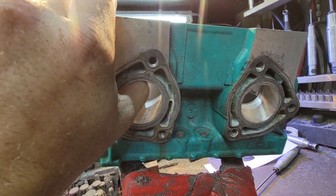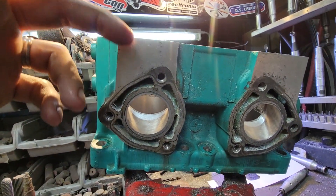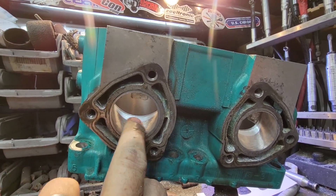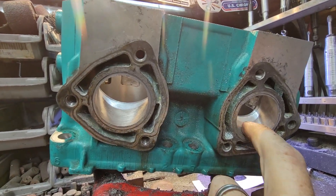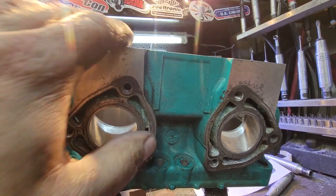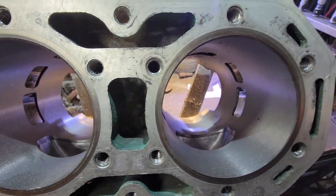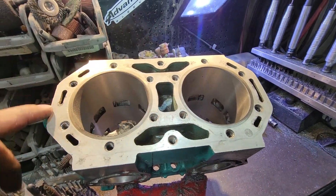You've got to remember, all your air is traveling on this top surface — where the exhaust is coming as the piston's going down. You don't really have airflow over here. That little divot or dimple — it's like a little rectangle in some of the cylinders — is not going to affect you in any way, shape, or form. Don't go too crazy. Obviously you want everything to be nice, clean, and even, so we open up here so everything's even.